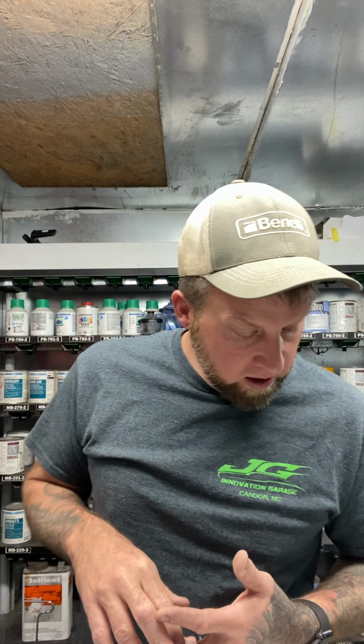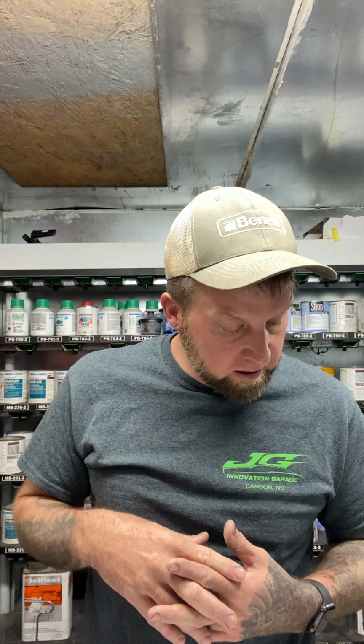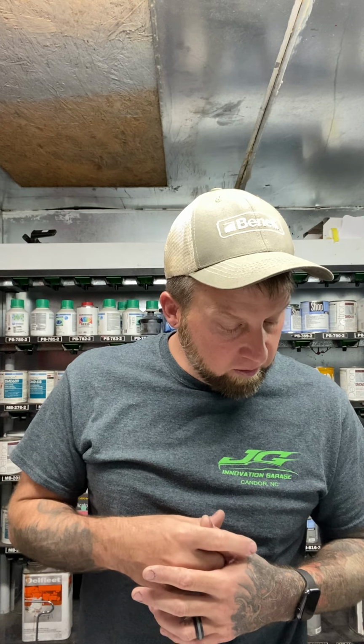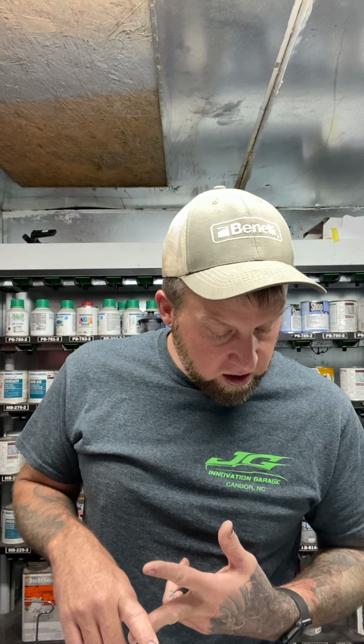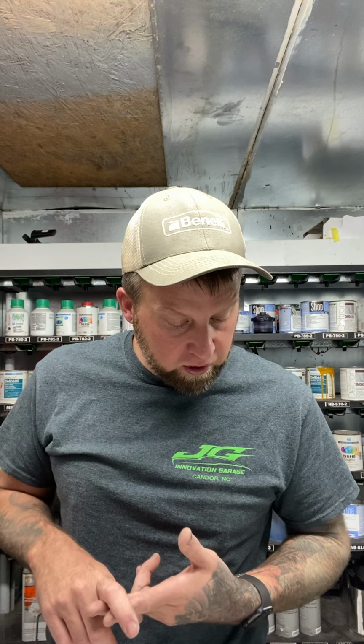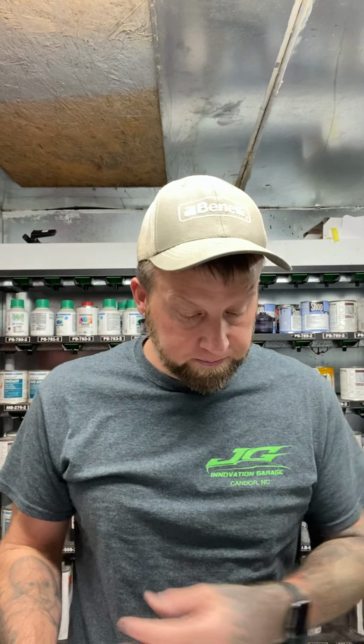All right. Then you have chemical stripper. Aircraft stripper must be neutralized with water, and it must be environmentally compliant. The pros: the best for original paint. Cons: messy job, leaves metal smooth, does not remove rust, slow for cars of multiple paint jobs, and does not remove filler. Also, you have dipping, where you can send the car off and have it chemically dipped. The whole thing can be dipped. Chemically stripped bare metal, all right.